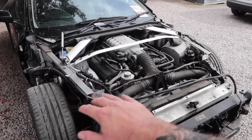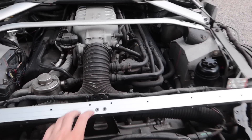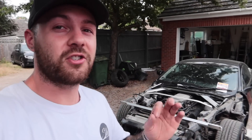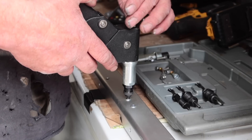We needed to replace the headlight support bar which runs across the front — it was damaged in the accident. We tried changing it in the last video but the part wasn't threaded right. We now have a new one, which gets riveted and bonded into place so we can attach the headlights. I've also got the new panels secured and they'll hopefully start going on the car later in this video.